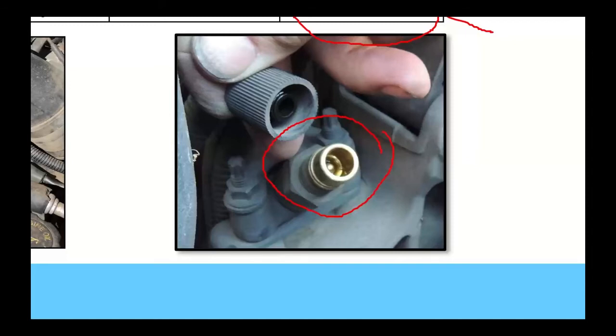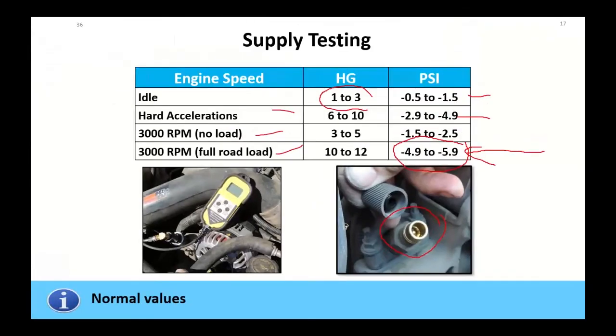And remember that what's on the other side of that valve is negative pressure. The higher pressure is going to be on the atmosphere. So there's a very good chance that in situations like this, you're going to be sucking air into this thing. You're going to have a performance-related issue. It's got no power, and you're also doing damage to that high-pressure pump at that point.